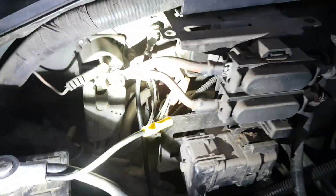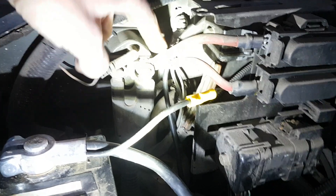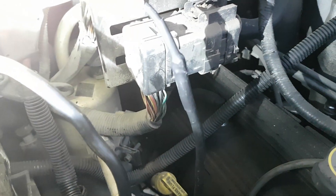This is also a part of the original wiring, and instead of running to the battery I now have it going down — I actually soldered it and heat-shrunk it to the heavier battery cable, to that other grounding cable. You can run new wire if you want; I had the wire and after cutting off the bad stuff it looked pretty good.